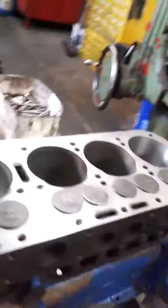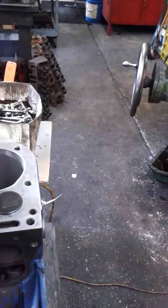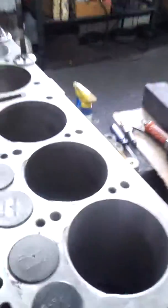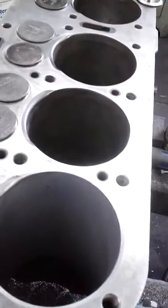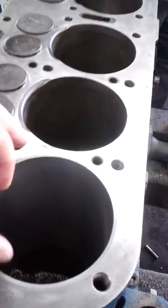Then of course there was a second sleeve. What was the damage? I can't remember. It was pitted plate in there. Oh yeah, pitted plate — so it didn't have a big gouge out of it, but it was badly pitted. So we were concerned about that one, and so we sleeved two cylinders.